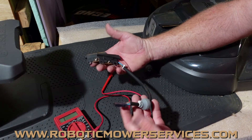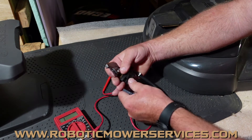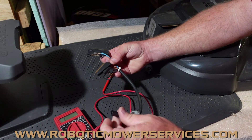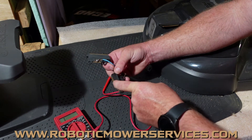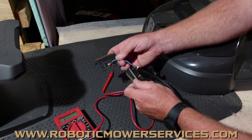So that's how you do it — it's real simple. You just need a multimeter and do a simple resistance check. You want to have one ohm or less between the connector out to where this makes contact with the charging station connections.